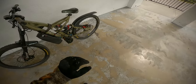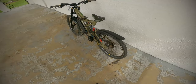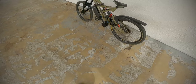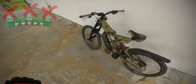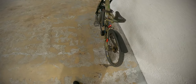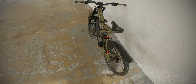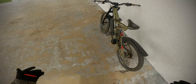As far as my other bike goes, that one is kind of on the back burner for now. I'm going to get a whole new kit for it because the hall sensor is kind of burnt. The new one I received — I didn't know how to take out a hall sensor. The little rods that were soldered onto the hall sensor broke off because of the force I had to exert to get into the hub, and it was a lot more complicated than I thought. I ended up snapping the rod connected to the hall sensor circuit board, breaking it in two different ways, making it pretty much defective.